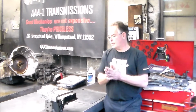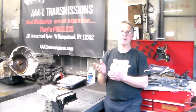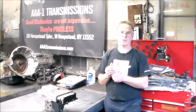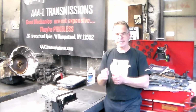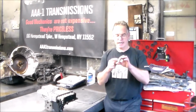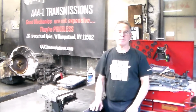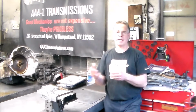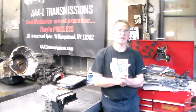Alright, so the car came in, and pretty much the linkage was frozen. This setup is very similar to the Land Rovers. We've probably had 3 or 4 Land Rovers come in, and the shifter was very tight. Down on the bottom is kind of like a pivot where, as you move the cable, it has to pivot, and it's frozen in there. I guess it's like a bushing, and it was frozen. It's all on the bottom, and you pick up all the elements from the winters and all the stuff on the roads. So that eventually froze up, so we got that nice and free.